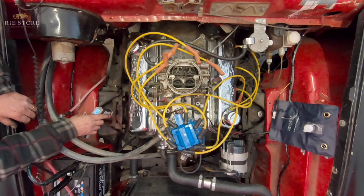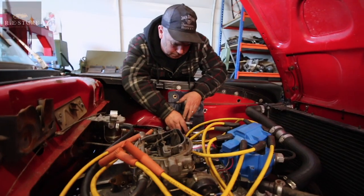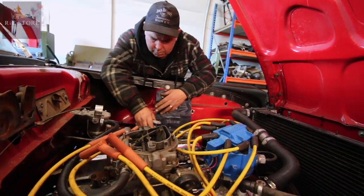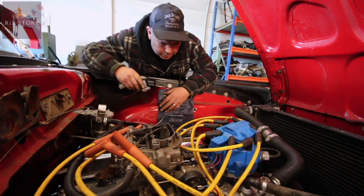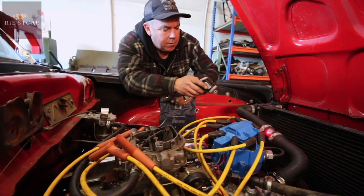Number one's very low temperature-wise. She's just checking the temperature of the spark plugs - just the exhaust ports. That one's hot - 73. Anything between 70 and 90 is about right. So that number one is cold. What would cause that? Not firing. Hence the misfire.